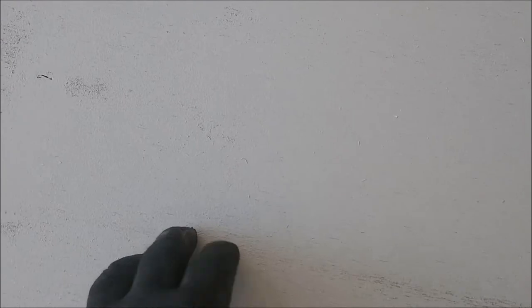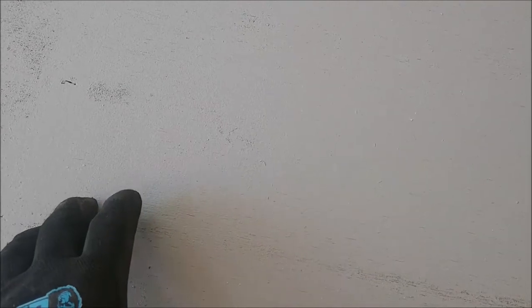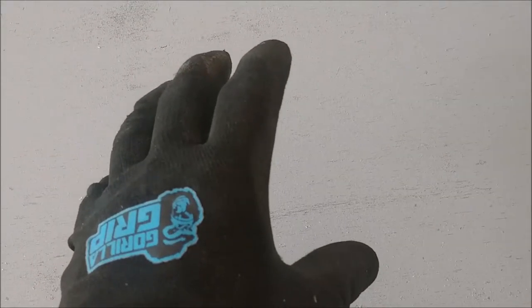I think what I'm going to do now, my plan was always to put some liquid nail on this, try and seal it up at least around the edges, make sure nothing gets into this area as much as possible, but also to hold it up because I'm putting plywood up against the metal, which is then going to be sandwiched in between another piece of half-inch plywood. So I figure if I glue this with liquid nail and also screw it, there'd be less chance of any movement or water seepage or anything getting in here. That's my thinking anyway. Hopefully it'll last a long time that way.